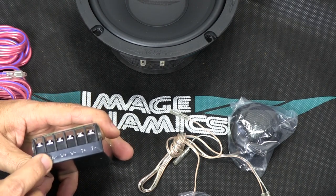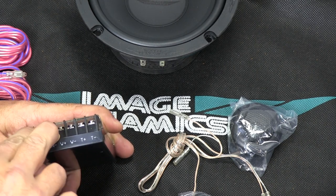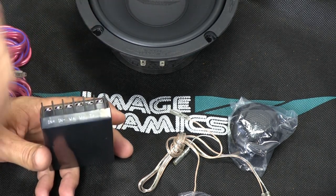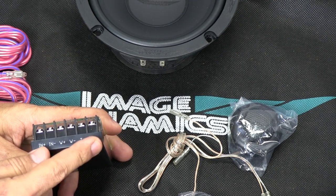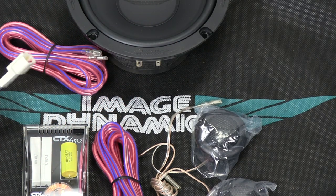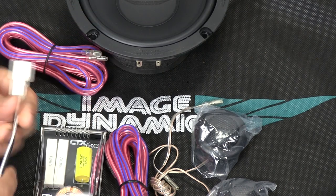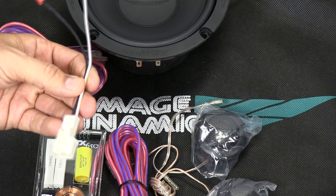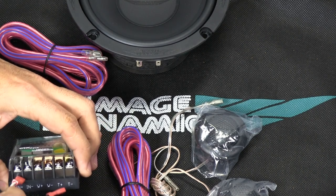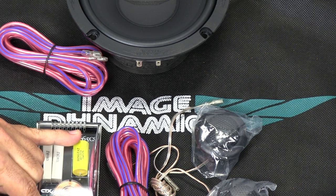Basically here we've got an IN — this is coming from your head unit or your amp, so you've got your positive and your negative coming from the wiring from your truck. The W is for your woofer or mid-range driver — again, that's your positive and negative. Then you've got your tweeter positive and negative. We offer a wiring harness kit as an option on our website. If you're planning on powering these from your head unit or an aftermarket head unit, what you can do to avoid cutting any wires is purchase this harness. It plugs into where the old stock wiring was, and then the white is your positive — plug it in here — the black is your negative. You cut these, attach them here, plug this into your existing speaker wire, and you don't have to cut any wires in your truck.